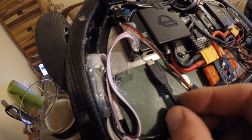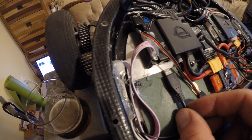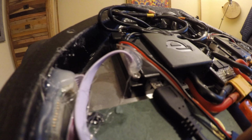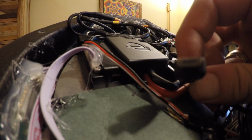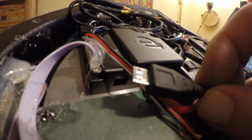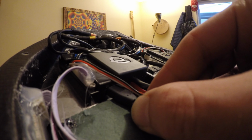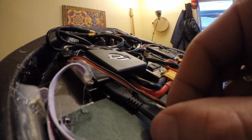You want to be using the latest version of the software. Generally, it's going to make your life easier and do a better job, and you'll be less likely to hurt yourself. So if you look down here, there's a little connection on the side of this. We access it from below with the 4-pin connector with the tapered side down. Okay, which is, to me, that's right side up. So the flat side up, the bigger side up. And if you're forcing it, you don't have it yet, it should just pop right in there real easy once you get it lined up.